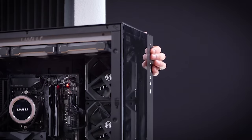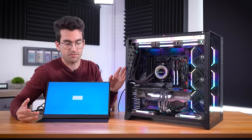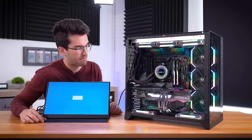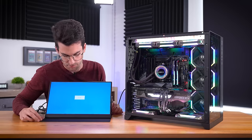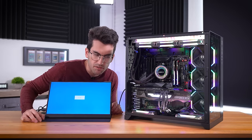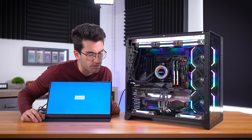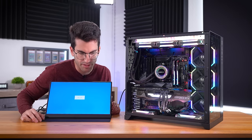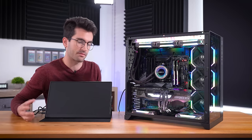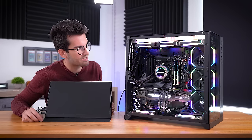Power on — let's see if we get a post. It powers on right away, which is as described. That's good. We need to make sure that what we're seeing here lines up with what the viewer has listed in the description. It doesn't sound like fan curves have ramped down at all, so I actually don't think at this point it is posting. It's not necessarily that we don't have a picture out — that's probably a good sign because this is an expensive 3080 Ti.